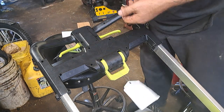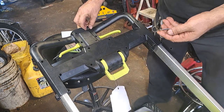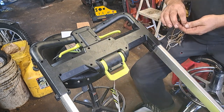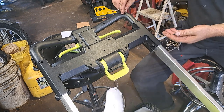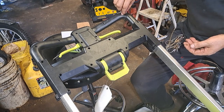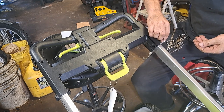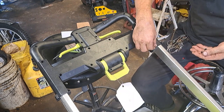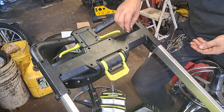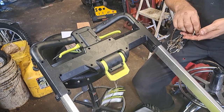So it's obviously something besides the switches — all the switches work in order. Maybe I'll do another video on this at another time where I'll pop the motor section apart, but it's brushless so there isn't really much we can do with that. Everything else is working so the battery's got juice. The only thing I can think is that the motor is gone, or maybe a controller — though if the controller were bad I would think the drive wouldn't work either and the lights wouldn't come on.